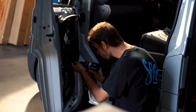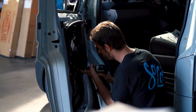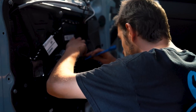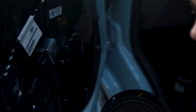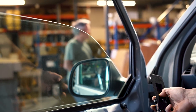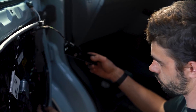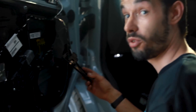Next step: you want to drill the rivets out, then take the little speaker out. It pops out like that, and there are two little spring clips — that's your old speaker out. It's worth mentioning: pop the window switch back in and put the window up, because for the next step — popping the rivet backs out and mounting the speaker — you don't want any screws to hit the glass, because you don't want to have to replace the glass in the door.